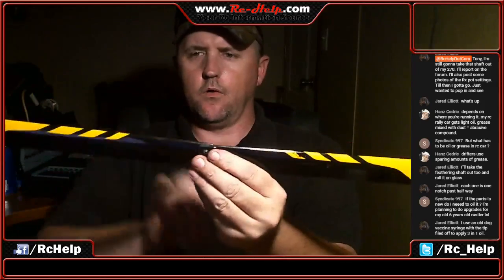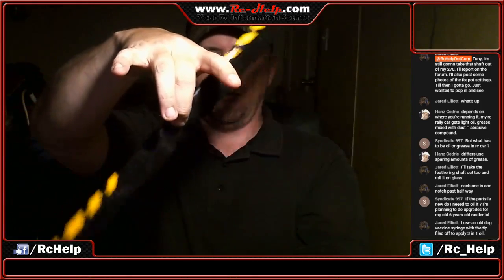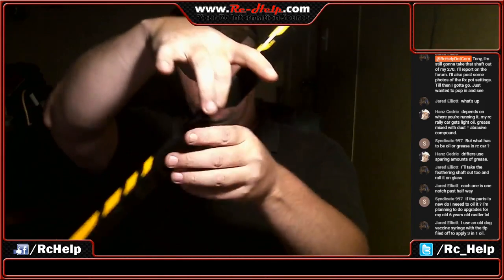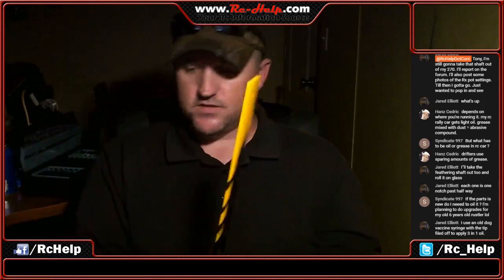Anyway, I bolted the blades together with the bolt that came out of the blade grip. So we're going to take it leading edge down. We're going to get them flat, and then you just hold it. See there? It's a crude balancer, and it's free. So this blade is going down. The weight on that blade was 2702. This one right here was 2424. They do this for props, so if it works on props, it'll work on these as well.